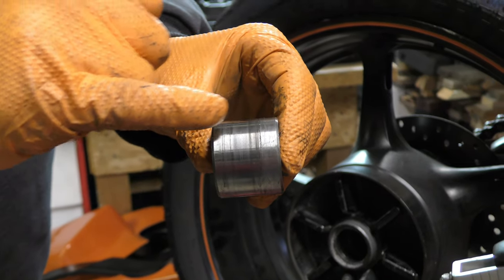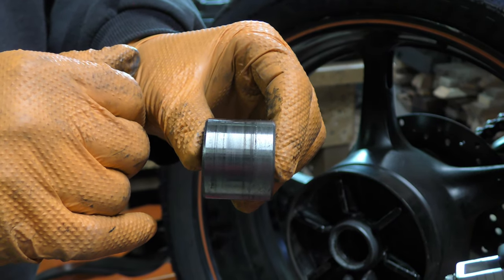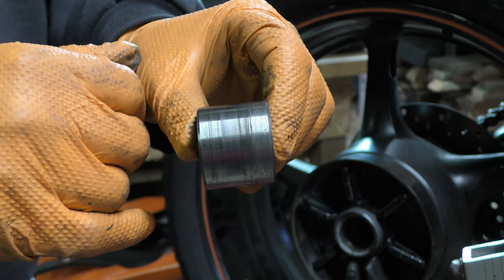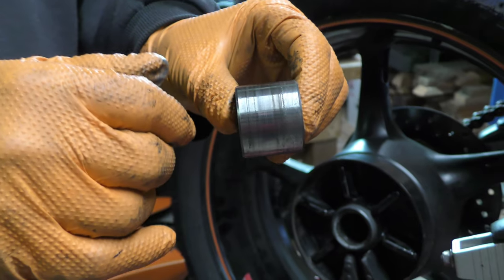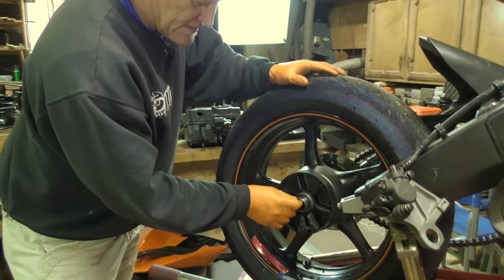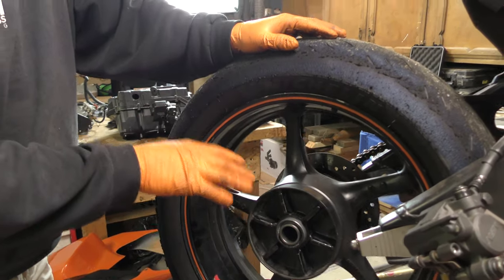You can see where it's been running from the tracks, but the grease dried out. The last time it was greased was about six track days ago, so obviously with heat — especially the summer heat — the grease just goes away. We've got to take care of that. Dust seals are okay.